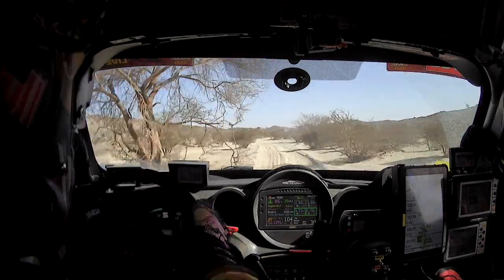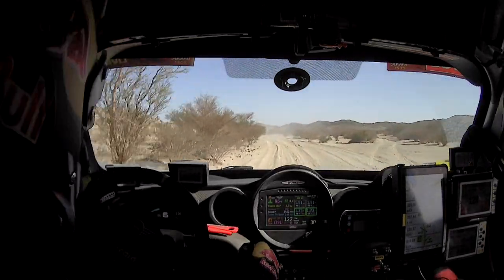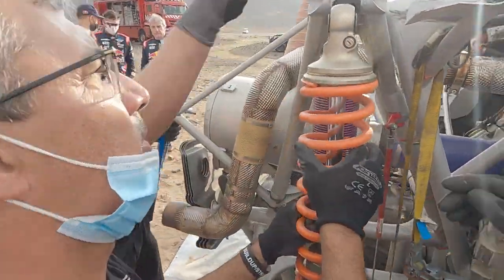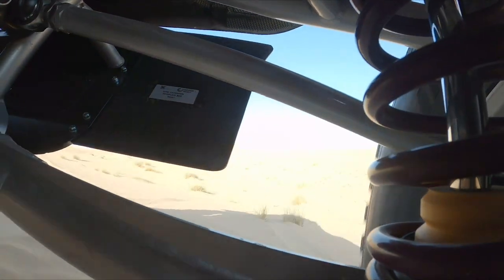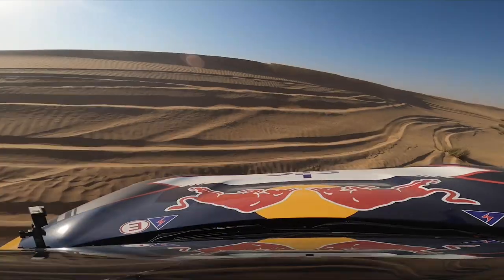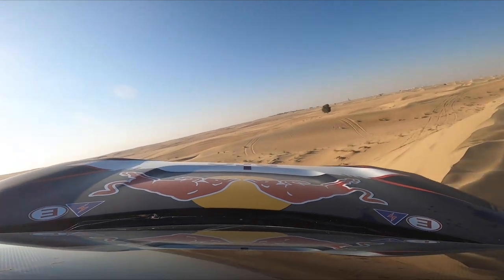Teams spend hours and hours and hundreds of kilometers testing their tires, suspension systems, and shock absorbers. A key part of the system is the shock absorber, and the shock absorber isn't that orange thing you see here — that's the coil spring. The coil spring is a powerful tool with a ton of kinetic energy. When compressed, it's going to rebound fast. That's where the shock absorber comes in — it controls the rebound from the coil spring.